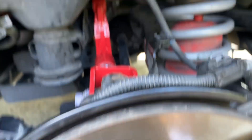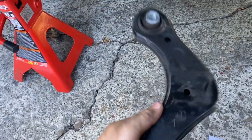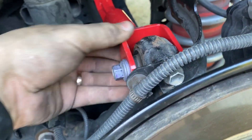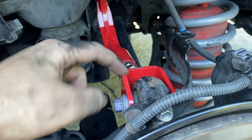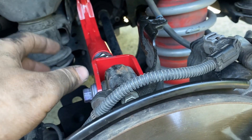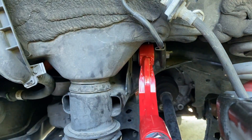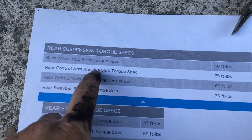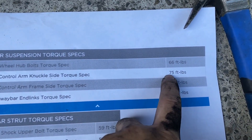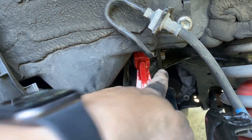She's loosely installed. This is actually easier going on than taking it off, mostly because it swivels and it's adjustable, so there's more play to get this around the knuckle. I did this side first just to line it up to the knuckle - that's easier. Once you get the bolt, just pop it through, then pop the bolt through back up there. Now we've got to torque it. The rear control arm knuckle side gets 75 foot-pounds and the frame side gets 66.